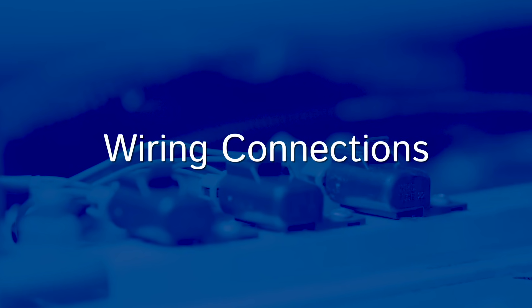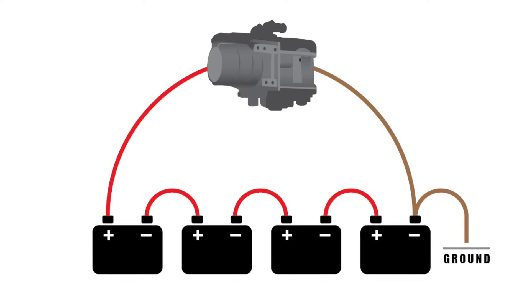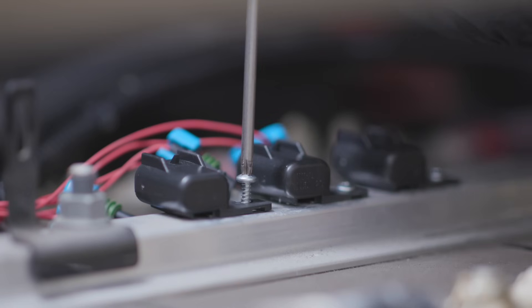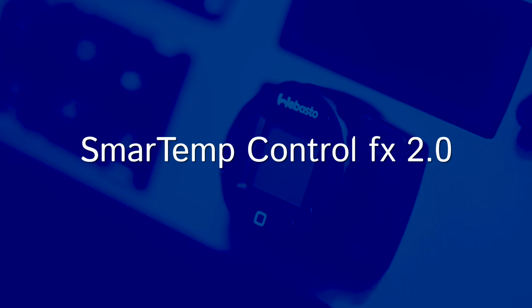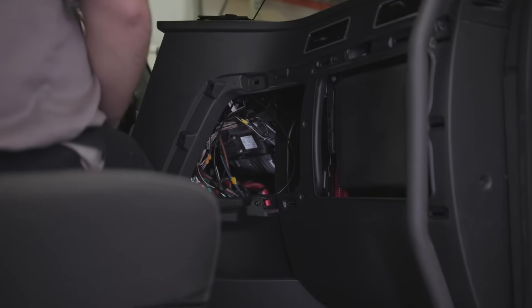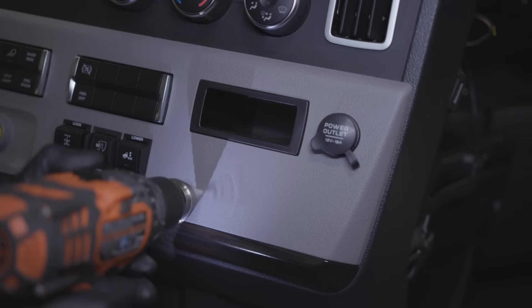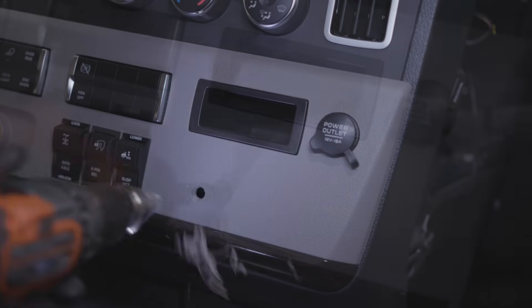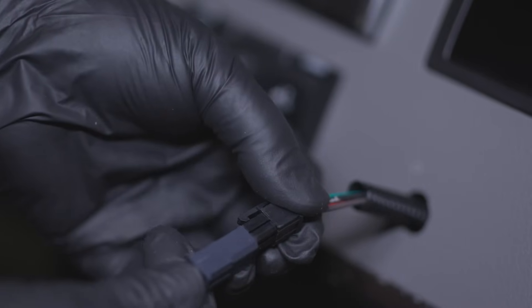Before you begin any electrical connections, insulate all wires that are not required against accidental shorting or grounding. Fuse all connections within 14 inches of the battery. Connect the heater's positive and ground wires across all batteries. Once the battery connections are made, plug the main wire harness into the heater. For the timer, select a good location on the truck dash and route the wire harness from the timer to the heater. Before drilling any holes, make sure there is nothing behind the mounting location. Once clear, drill two holes and secure the control with the two supplied number four screws. When that's done, connect the SmartTemp wire harness to the main wiring harness.